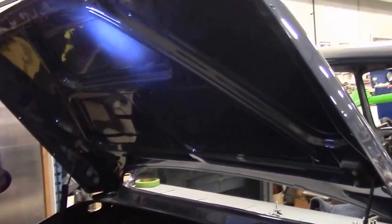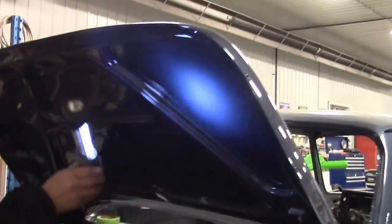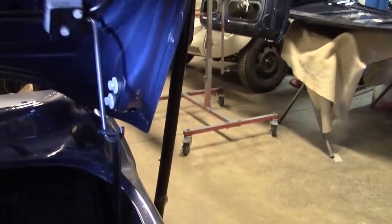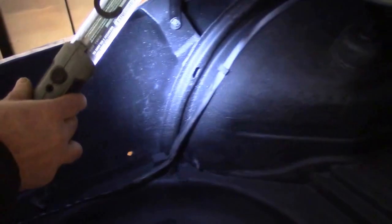You can see the detail of the trunk lid. Not only did we paint the bottom side of the trunk lid and do it properly to match with the paint, but then we removed all of the guides, support rails, and hardware. You can see our return spring and the little clips that retain everything properly. That's all been done separately — the rods have been sanded, they were all rusty and had overspray on them, so we've sanded them and painted them in the proper black color, and we have all the clips and bracketry put on.